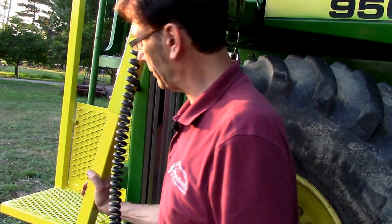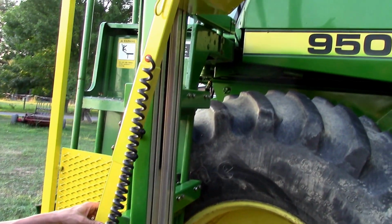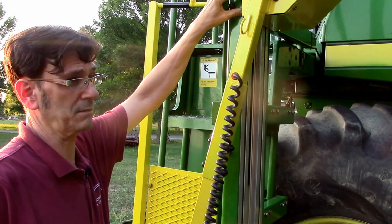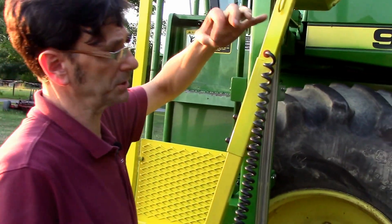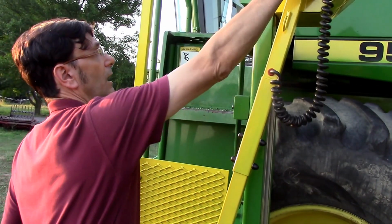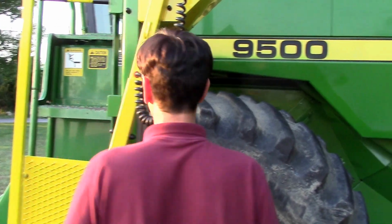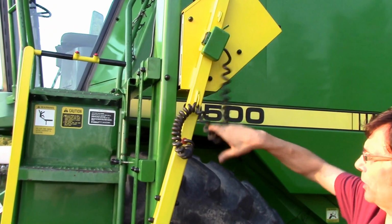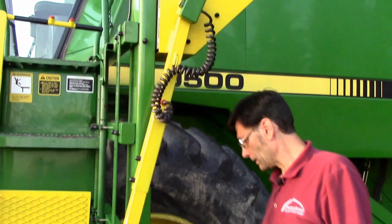If the trolley starts to have excessive slop, which we kind of doubt, but it certainly could happen, then you need to call us and replace the bearings. There are, I think, 8 bearings inside there. And they have a special bushing that goes around them that's made of oil impregnated plastic. But again, that's for on down the line. Make sure that you hook this when you're traveling, because otherwise eventually the jarring on all that will cause problems later on. And that's pretty much it.